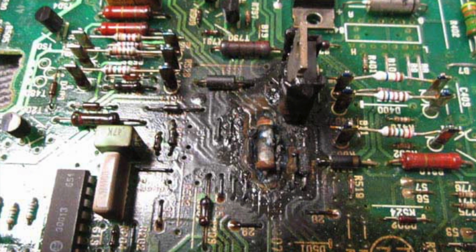Let's go back to the original picture when the battery was all dirty and full of acid and dirt and everything. So all that acid becomes a conductor, and if it creates a path from your negative post to your positive post, it creates a direct short. And what it can do, it could fry something like your computer or another component, and you really don't want that because then it becomes very expensive instead of just getting a little box of baking soda with the sprayer bottle and a paper towel. That's all it takes. You can save yourself a lot of money and a lot of pain.